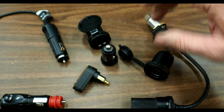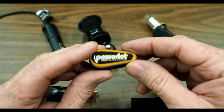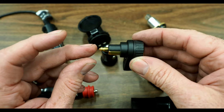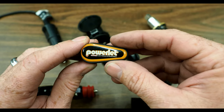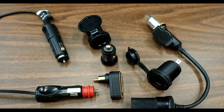What I do on my refrigerators - on my last build and on this build as well - is remove the stock plug completely and replace it with a PowerLet 90-degree male plug. I've got a PowerLet port already installed in my van for this purpose. When I plug this connector in, it snaps in, it's nice and secure. The 90-degree plug allows the cable to hang tightly to the wall so it's not sticking out where it's going to catch on something. It just makes a really good connection for the refrigerator, where you really want to make sure you're not going to accidentally lose power as you travel down the road. Highly recommend those - a great product.